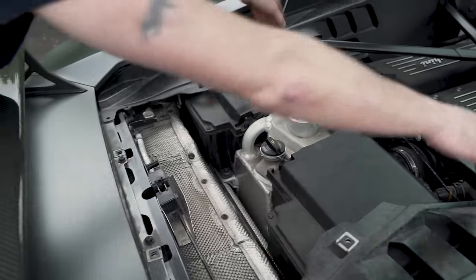Make sure you do that if you've got the old-style tire pressure cover. Other than that: oil every year, oil and filter every year — every 12 months or 10,000 miles, whatever comes first. Pollen filter and brake fluid every two years, plus your oil. Then every four years, those three things plus transmission fluid, front diff fluid, Haldex fluid — and make sure the people doing Haldex fluid reset the Haldex motor. Also gearbox oil, spark plugs, and air filters. There is a fuel filter, but it's in the tank — not external like the Gallardo or the Gen 1 — so it's not really a serviceable item unless you have suspicions of a problem.